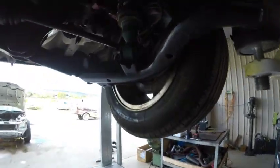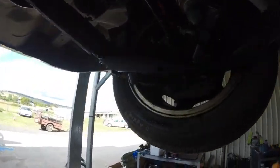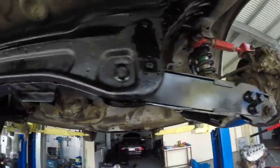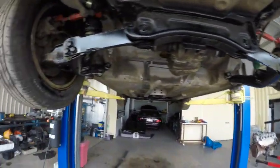I'll take it down and show you what we did in the boot. That's the brake setup in the rear control arms. I'm going to make a mount for the sway bar — the original CRV sway bar is going to bolt onto here. I'll have a look at its movement, but I'm pretty sure it's going to clear the floor, so we'll be able to have a rear sway bar mounted as well.